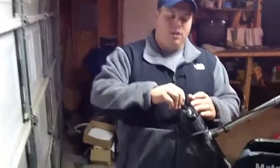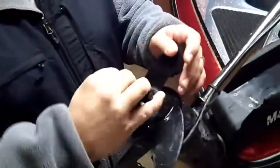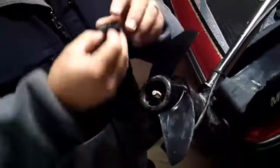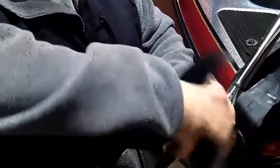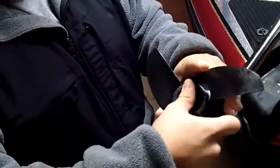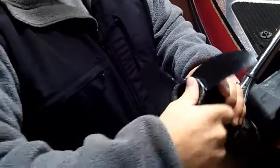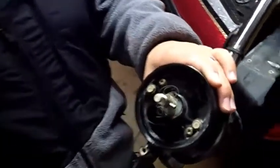What you do is get your tool, get on the little pin here, and twist it to the left. Once you loosen it up, you can take that off and twist it off with your hand. Then you want to slowly wiggle your prop loose — sometimes it's best to put your thumb over the pin there. That was a little hard to get off because we do have line actually wrapped around our prop.